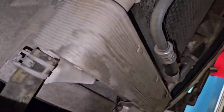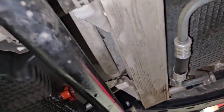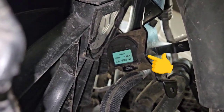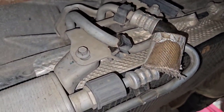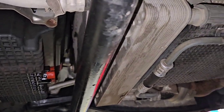Ford does something that makes zero sense. We're going to slide underneath and look at this Ford — that is the cooler on the new 10R80s, and all it has is coolant lines running into it. Those coolant lines run up to this valve right here, and that valve controls the coolant flow down to the cooler. That's the only way it cools — via that valve. The 10R80s on the trucks do not have a thermostat; it is only that cooler and the valve that controls coolant to it.